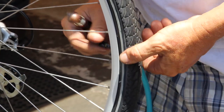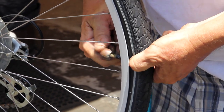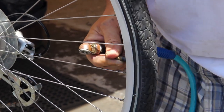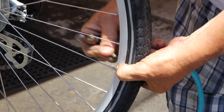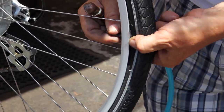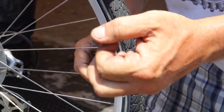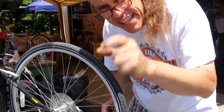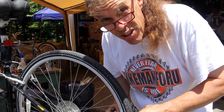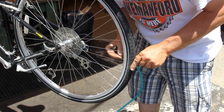If that is the case, you've got to let all of the air out of the tire and make sure that the valve goes in and out nice and freely. What you've done is pulled the valve down so tight that the tire is not seating right, because the vulcanization — that's where they attach the valve to the tube — is a little bit thicker and it's not seating the tire properly where it needs to. So again, make sure that your valve goes in and out.